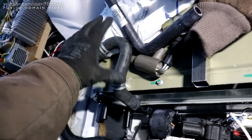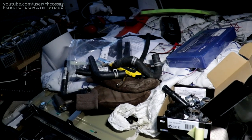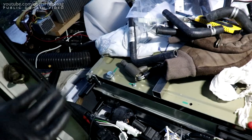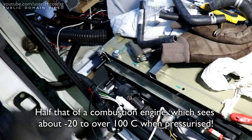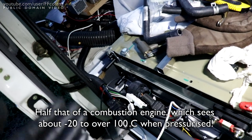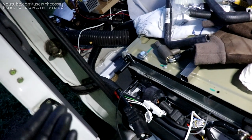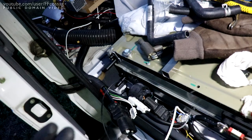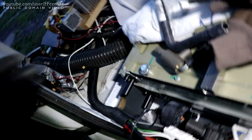This system isn't going to have as big thermal fluctuations as a car engine, so we don't need a very big expansion vessel — probably just a random piece of tubing with a plugged end so we have a bit of air that can compress. At worst this thing is going to see about 60 degrees of change: if it dies in the middle of winter it might get down to minus 20, and on a really hot summer day it might go up to 40°C. Thankfully we don't have any boiling or pressure issues since nothing is trying to get the water to boil.